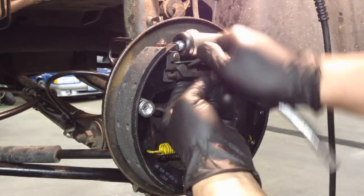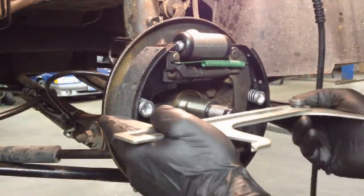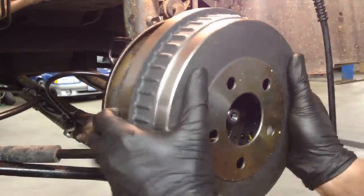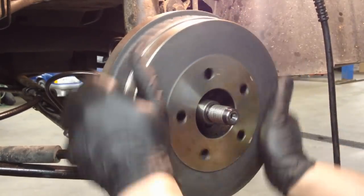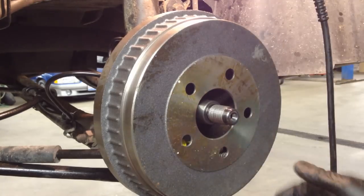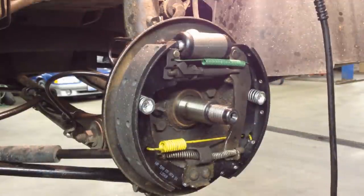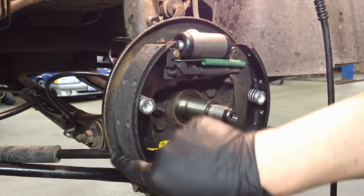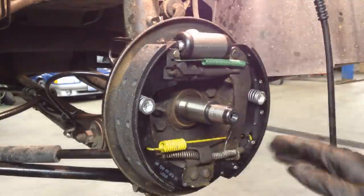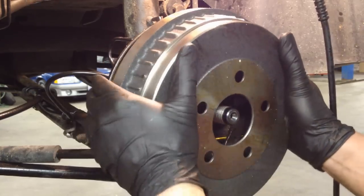You'll see more and more threads and you'll know you're going in the right direction. That feels pretty good — nice and close. Even without the hub, I can feel it has a nice light drag — that's perfect. If you can't get your drum on and they're all the way in, adjust the shoes up and down so they follow the circle of the backing plate, because one side may be cocked way up. Even them out and the drum will fit right on, then once the drum's on it'll self-center and keep them in check.